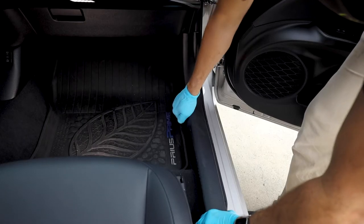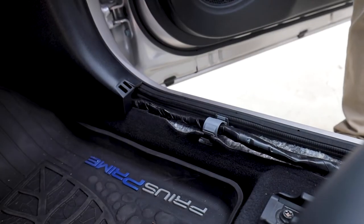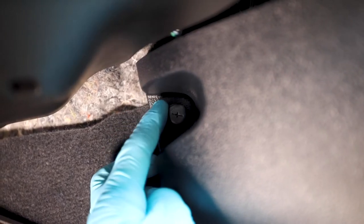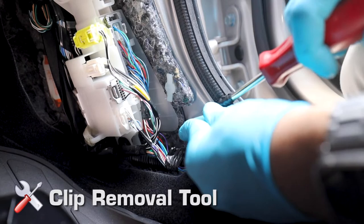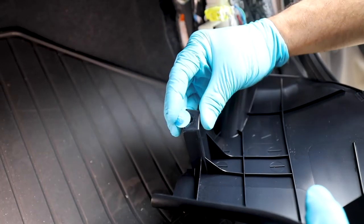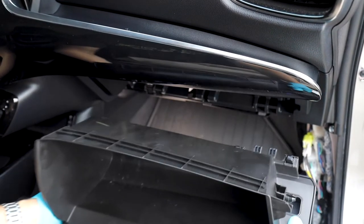Prepping the pathway for the quick sync wire and harness. First, lift the threshold on the passenger side of the vehicle — it lifts up directly out of its rested position. With the kick panel, remove the bolt by turning counterclockwise, then pull the panel away from the passenger side towards the driver side. If any clips stay in the vehicle, use a clip removal tool to put them back on the panel in preparation for reinstallation. Remove the glove box by squeezing the sides and pulling down and out in one motion.